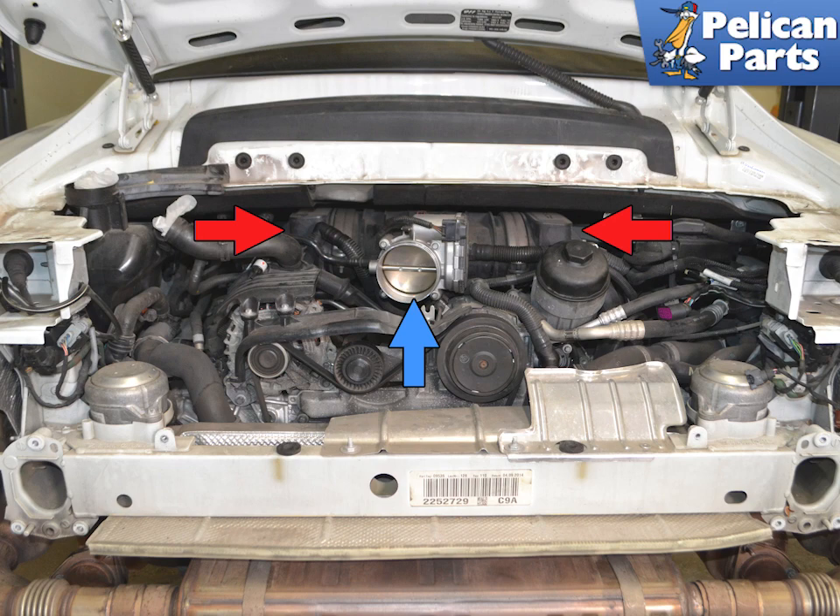The intake manifolds are connected to the throttle body and the resonance tube. You will need to remove the engine cooling fans, rear wing, tail lights, rear bumper cover, throttle body and resonance tube, and perform a partial engine drop. Please follow the link provided at the end of this video for assistance with all of those tasks.